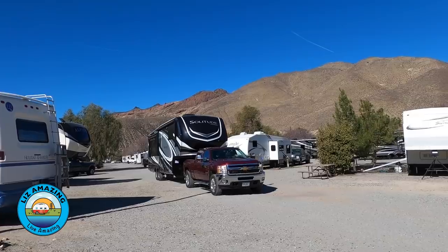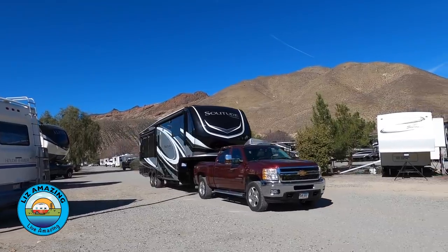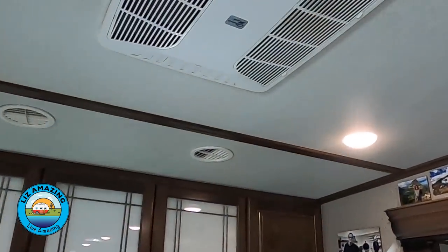This is one of those things we're all faced with — to buy or not buy for our campers. I've known about Soft Start pretty much since I started RVing, but up until now I never installed one. And I'm sorry — the only thing I'm sorry about is that I didn't do it sooner. It makes a huge difference inside. It's so much quieter. We didn't count on that — we were just thinking about the 30-to-50 amp issue. But when it kicks on and off in the camper now, it is much less sound and feel.